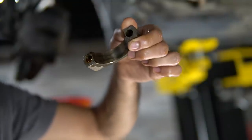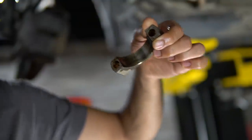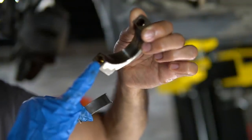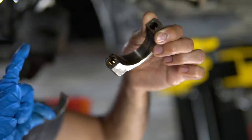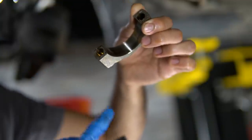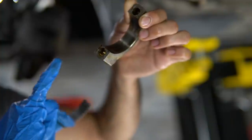If there's any damage in there, you kind of really don't have that many options. You got to take the engine out. You're going to pretty much start rebuilding it at that point. And the main reason for that is because these are crack rods. So this cap only goes to that actual rod. So you want to make sure everything is put back the exact same way. The reason they crack it is because when it's cracked, it's going to be a perfect fit.